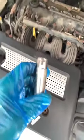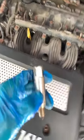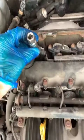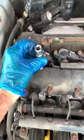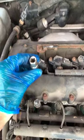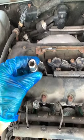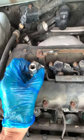The thing is, you have to use a 5/8 spark plug socket, right? Okay. Now, when you go in there to remove the spark plug that's inside and you start turning counterclockwise, don't freak out. It's going to be very tight and rusted and you think, I'm going to break this thing. It won't happen. So once you start taking it off counterclockwise and it's hard, stop.